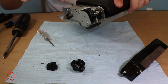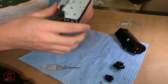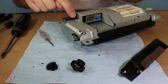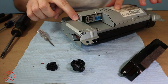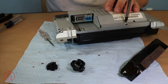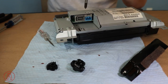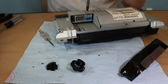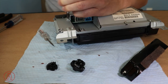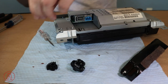Here you can see our motor and our gears. However, we still can't get to these gears because they're blocked by this panel. To get this panel off, we have to get this bracket off — but to do that we have an overlapping lip with a screw that is part of the main panel. So we are going to loosen these two screws; you don't have to remove them all the way, just loosen them. Then this third one is going to come out all the way.